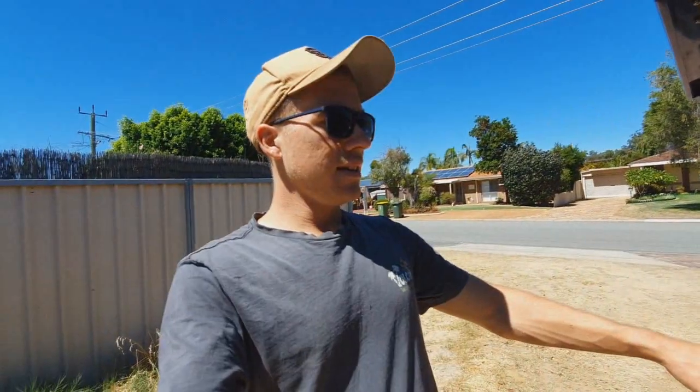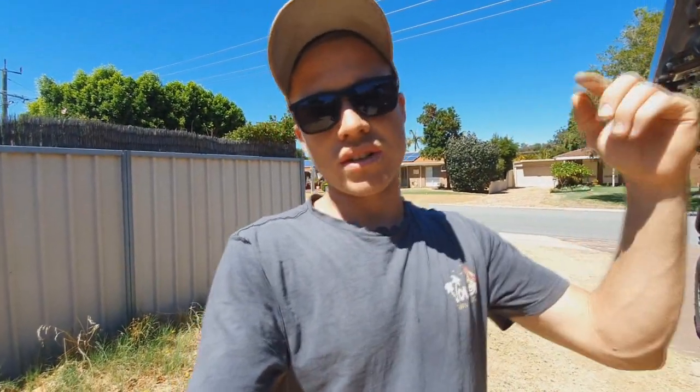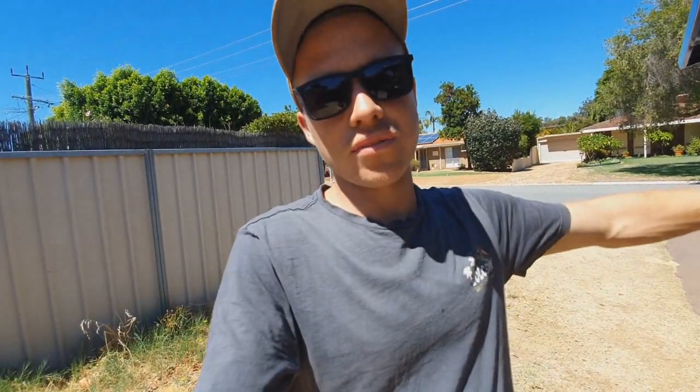Since getting the canopy, I have basically taken it off, flipped the underside and siliconed all the joins because I did see some rust coming through from underneath. The floor isn't dead flush all the way along. It has a bracing all the way around and then a small gap, so when you bolt it down it does kind of pull down on the floor, which you've got to be careful about, so I use some large washers for that.